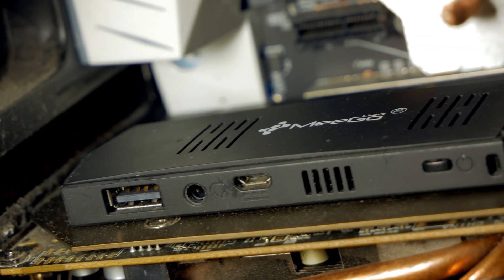I wanted to install a 64-bit version of the OS, but then it dawned on me that the 32-bit BIOS of this device wouldn't allow it. You're probably interested in the technical characteristics: four cores, two gigabytes of RAM, a non-gaming integrated GPU, two USB ports, a mini jack, SD card slot with 64 gigabytes maximum, HDMI output for a monitor, and micro USB for 2A charging. This device doesn't shine with its power.